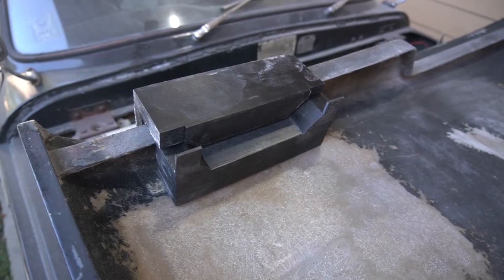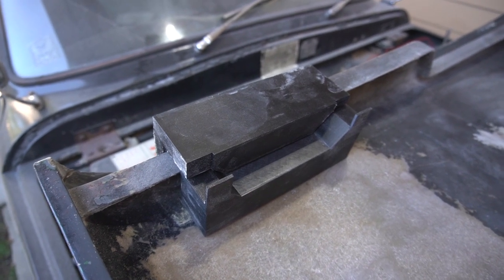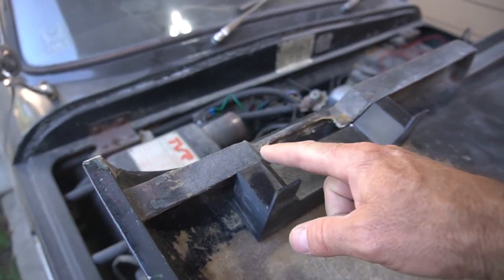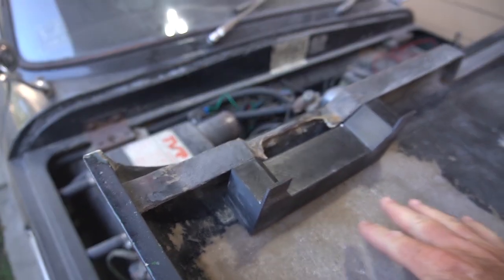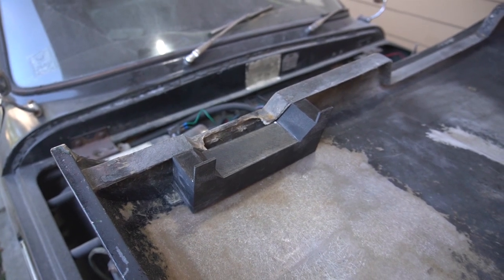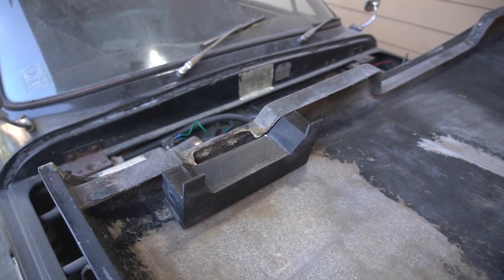So I'm hoping that the plastic doesn't warp too much. You know, fiberglass is an exothermic reaction, but I'm only trying to get one use out of this. And so my intention is, this is my intention. We'll see. I'll need to clean this fiberglass up, start trimming it back, start fairing the edge, and then I'll fit this mold in place a little bit better. And when I've got things fitted a little bit better, I'll be bringing you back, and I'll describe any difficulties I had. But I'll bring you back before I actually start the fiberglassing effort.